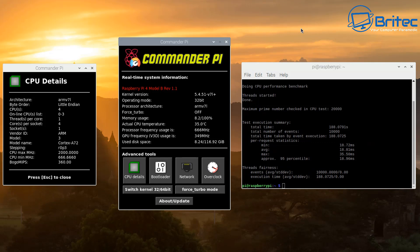You can also just hit the Reset button to put it back to default settings if you don't want to keep the overclock. But if you're happy with it, you're good to go. That's how you overclock your Raspberry Pi — Commander Pi is a nice little tool, so big thanks to the guys who created it. I'll leave all the information and links in the video description. Be very careful and don't overdo it, because you will brick your Raspberry Pi. Make sure you've got a decent case to keep it cool, otherwise temperatures will start to climb.